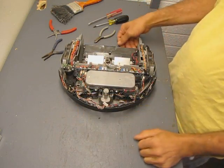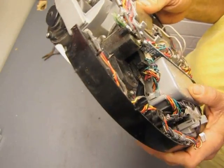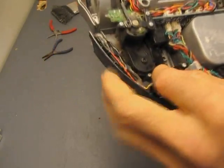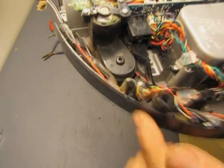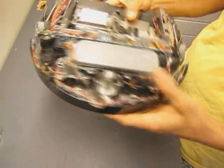We've got everything cleaned up, so let's start pulling stuff apart. Some of these units have hot glue all over the place that holds the wire harness in position; some of them don't. The ones with hot glue are a bit of a pain — be patient and careful with it. This whole front piece is connected with the motherboard in that the sensor pokes right into it. This is an infrared transmitter and receiver — the bumper bumps up against a wall and interrupts the beam, triggering it to sense a collision. The rest of the sensor bar in the front has four edge sensors in these recesses. It's also an infrared transmitter and receiver: it sends a signal down to the floor, bounces back up, and if there's no floor there the thing backs up and moves away.